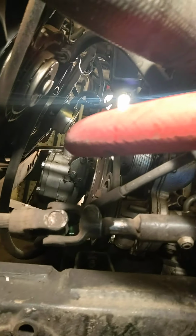But basically it's a Honda B pump mounted to the front of the motor. Sweet Engineering steering servo, so the steering shaft goes through the center of the box and goes out the other side, so you have an input for your steering box. I have a manual steering box, stock Suzuki Samurai. It goes through the steering servo to the box. I thought that was the simplest way to go. I didn't have to change the steering box. The steering servo worked really well.